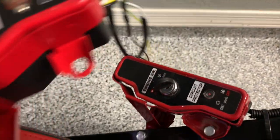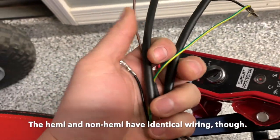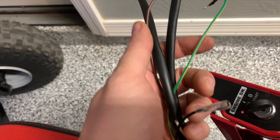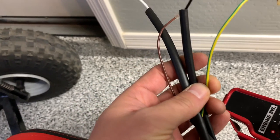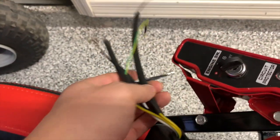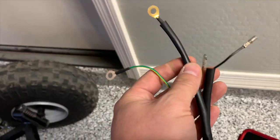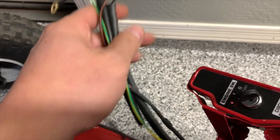Also, when you're ordering these things, they do come from different manufacturers — there are all sorts of different clones. They typically do not ship with wiring instructions, and at least the ones I've gotten have had wires of every color in the universe. When you find instructions, definitely don't trust the diagrams to color-match exactly what you received. Some days it seems like they just pull random colors out of the box. A few of these wires are for grounding — one is for grounding out your ignition coil, one is for the battery, one for the stator. Definitely get a diagram of what it should look like, but don't trust the colors.